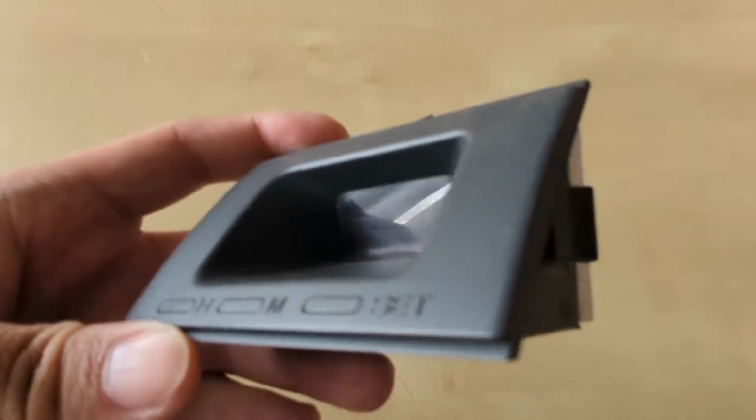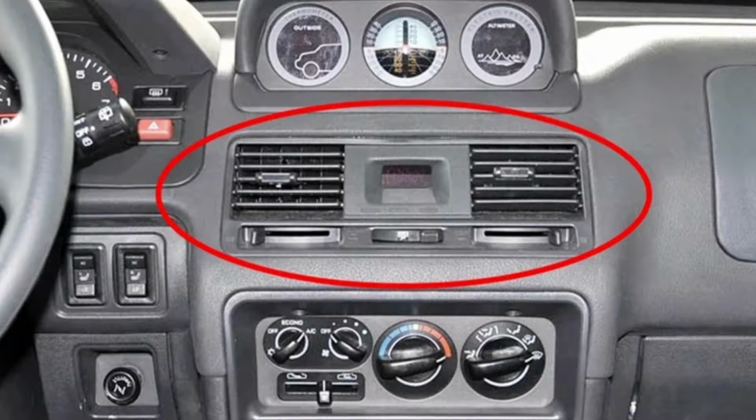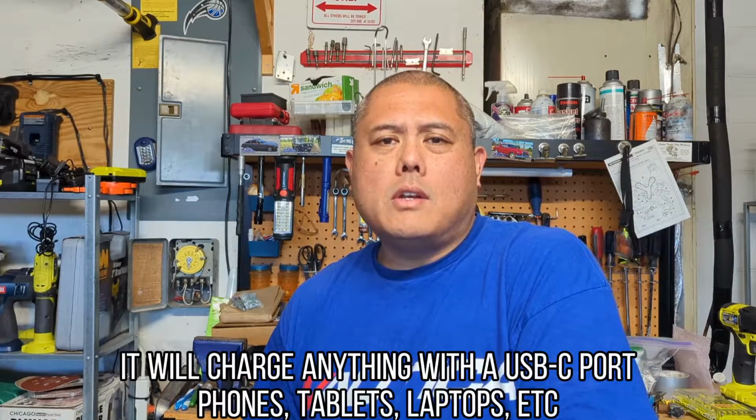So the product they released is a phone holder that replaces the factory clock on the Gen 2 and 2.5 Monteros. It's the clock on the center AC vent. You remove that, and it's literally a plug and play product that just replaces the factory clock. It acts as a phone holder. It uses the factory harness plug that plugged into the back of the factory clock to supply power to whatever the innards are to be a phone charger. There's a USB-C connector and all that good stuff.